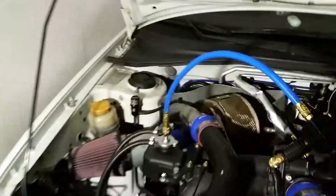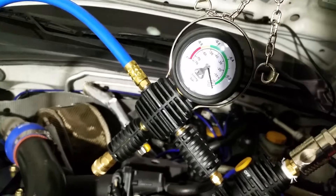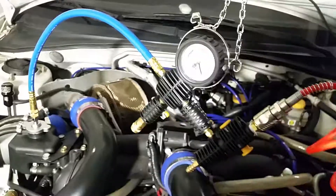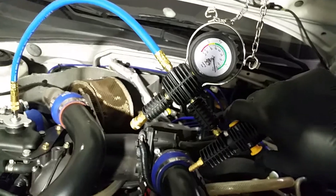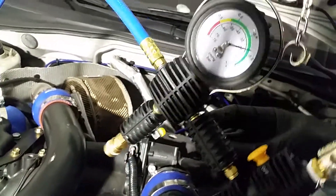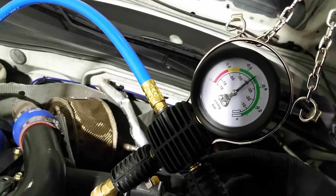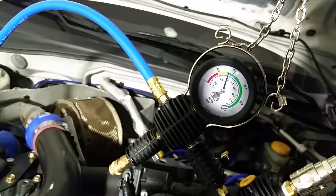I have my gauge here — you can see it's at zero. I have the adapter going into the refill here, the radiator cap is on. I'm going to turn on my little tiny air compressor — it will probably not make it all the way and have to turn back on. So I'll turn this on — just watch the gauge. I want to get it right to the end of the green here. I got it pretty close — it's holding.